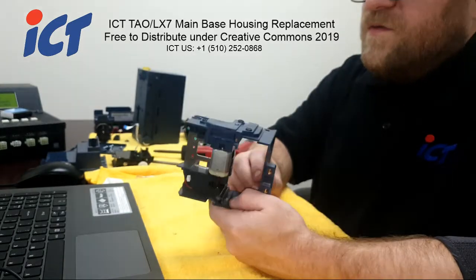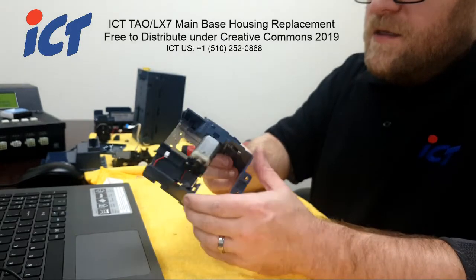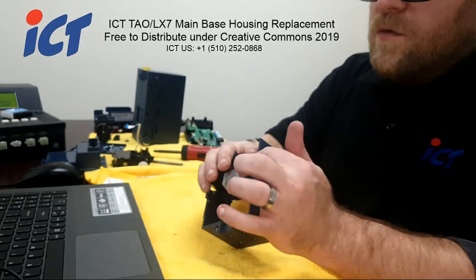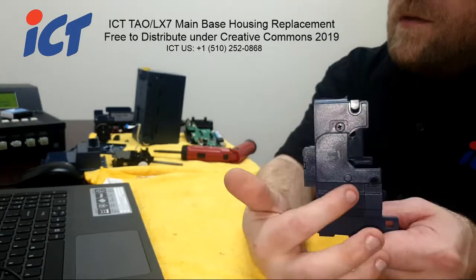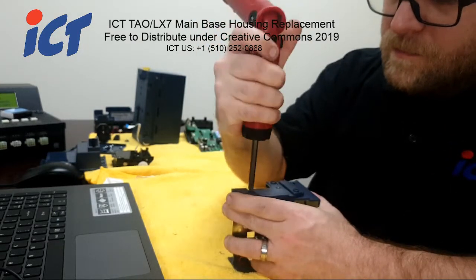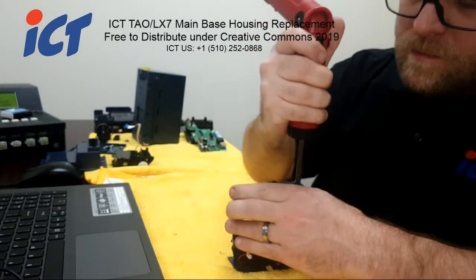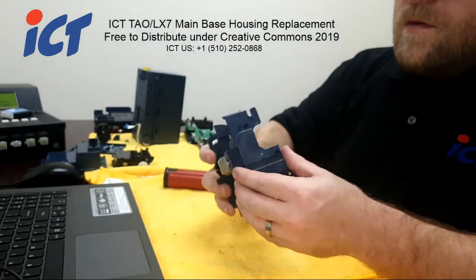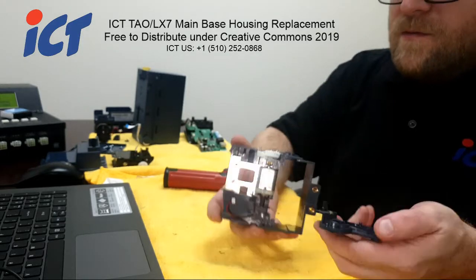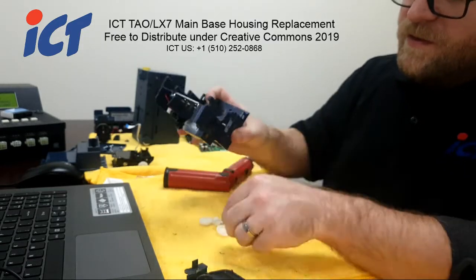And we still have to remove the drive motor and the gearbox. So the drive motor, as you remember from my previous video, you remove the 3 or 4 screws from the side panel, which will expose your gears. With those screws out, you could just pull your gear cover straight up. Since we're having to change everything, go ahead and dump out all your gears anyway.